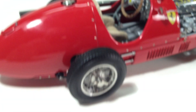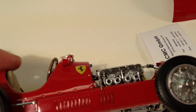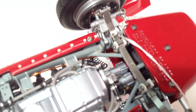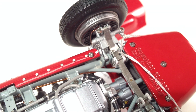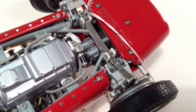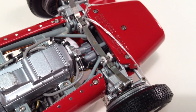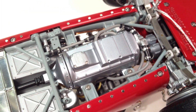Turning the car over carefully, we can see a lot of the detail better. Looking at the front suspension, it's an unequal-length parallel A-frame suspension with a cross leaf spring. The shocks — which are hard to see in the front — are Houdaille lever-action shocks, just like you'd find on a Model A or Model B Ford, and very common on racing cars of this period, especially after World War II.